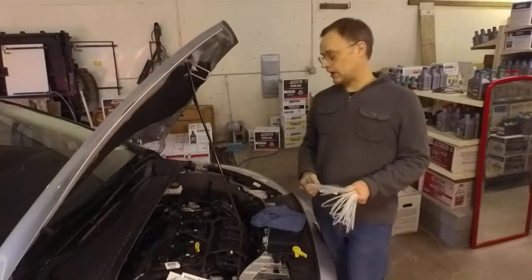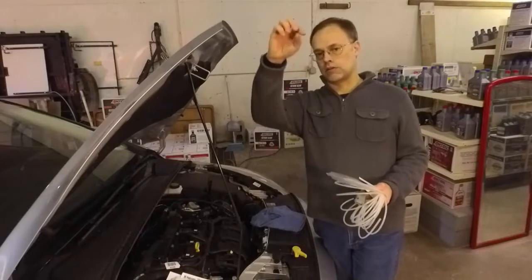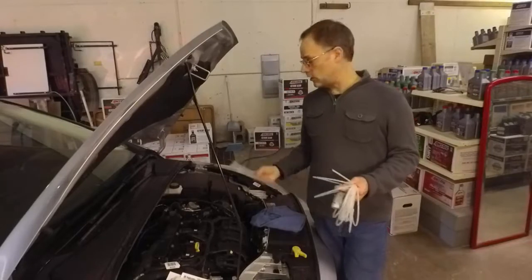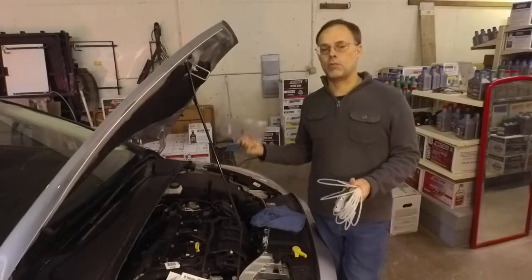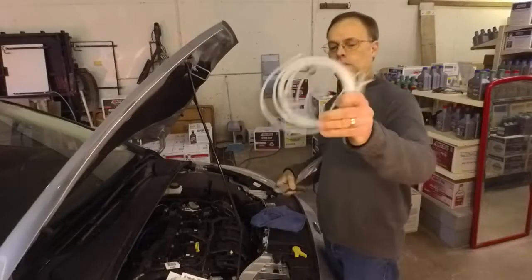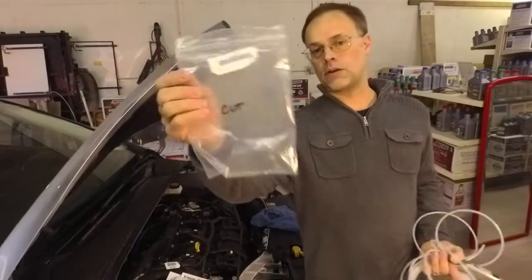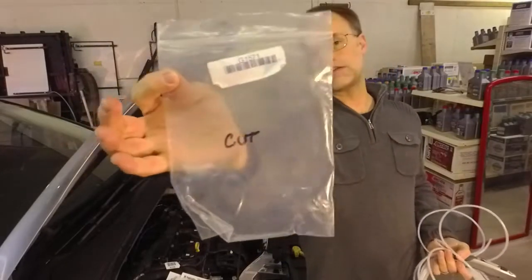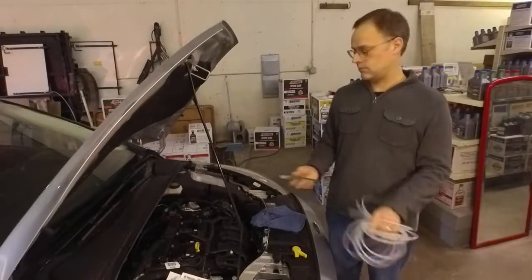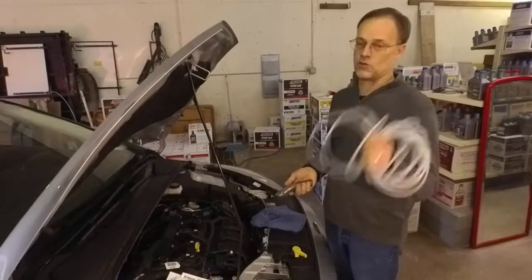First thing I'm going to do is cut the hose to the length of the dipstick tube so I can reach the oil somewhat below the top, getting the suspended oil. When you buy an analysis pump from us, hose comes with it. This is replacement hose — the G1571 — so you can order that if you're doing other people's cars and want to have enough on hand.